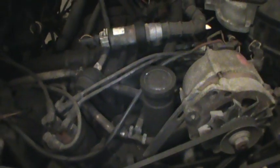It's been sitting for 10-something years. Put an oil filter on it and fired it back up again. It's nice and quiet now. When I first started to run it, the lifters were tapping away — you'd rev it up and it would kind of go away. Now, especially after the oil change, it's nice and quiet, which is really good.